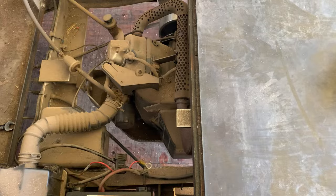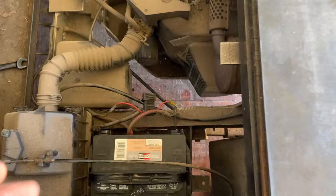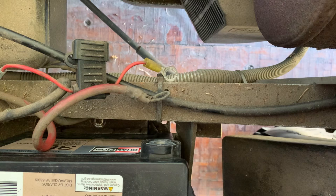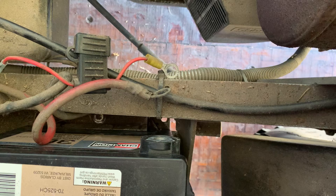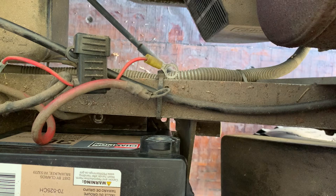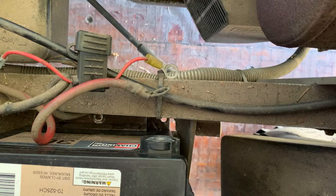Hey, what's going on — More Medic One. Today we're working on a golf cart and we've replaced the battery. We've load tested the battery and it is deemed dead. A good rule of thumb here is whenever you disconnect a battery, it's always best to disconnect the negative first and then the positive. Vice versa when you put the new battery in — hook your positive up first and then your negative, that way you don't chance interfering with the frame of the machine. If you have the negative hooked up and you go to put the positive on and you hit something metal with your wrench, you're going to arc it out.